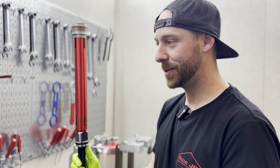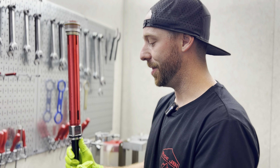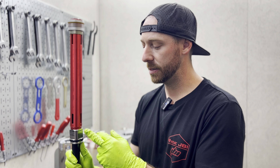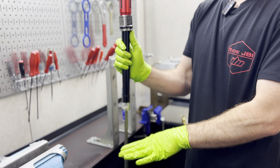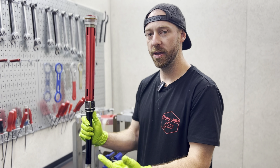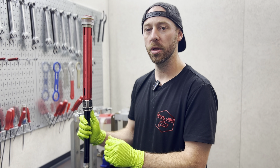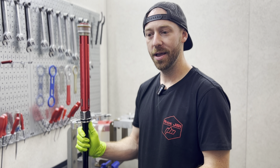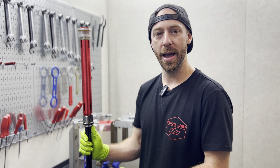I'm psyched because these are the first articles we got and everything is fitting perfectly — that almost is never usually the case. I was expecting at least one piece to be off a little bit. We are going to assemble these forks, get them on my bike, and we have another set of cone valve forks built to the exact same spec but with the OEM tubes, so we're going to test these back to back and share the feedback. If I'm a betting man, I think these are going to be the favorite fork because of improved bottoming resistance. We'll also be able to run less oil in the outer chamber, meaning this is going to engage the oil a lot lower in the travel, making the forks feel a lot smoother — similar to what we see with our pro perch in Showa and KYB forks. We'll get this installed and in a week or so we'll start sharing our feedback and testing. Thank you for watching.